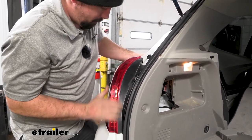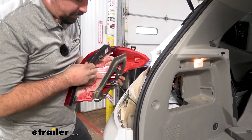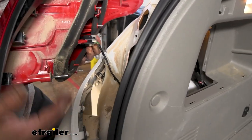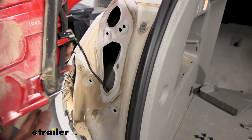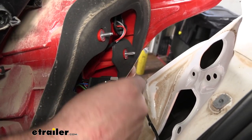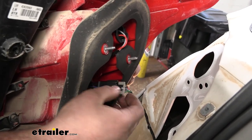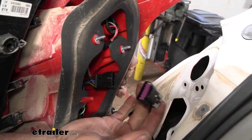Give it pressure along the taillight to wiggle it back and forth, and we should be able to get this to pop out. This is where we're going to be routing our power wire — there's normally a grommet or something to make it easy, but we're going to route it through here. Go ahead and disconnect our taillight so it's not hanging, and we'll be plugging into that here shortly. You're going to want to peel back on this gray clip — if needed, put a flathead in and pry that back. That's the lock, then push in the center and that should unplug pretty easily.